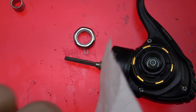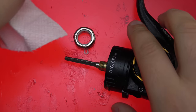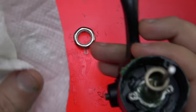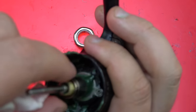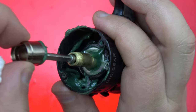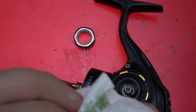So make sure you wipe your hands off pretty good. If you need to, grab this clutch sleeve with a paper towel and you'll see how it's got that cupped face on the top. That's how you know you got it going down the right way. And you can see there's too much grease down there, so we're going to back it out, clean it off again,